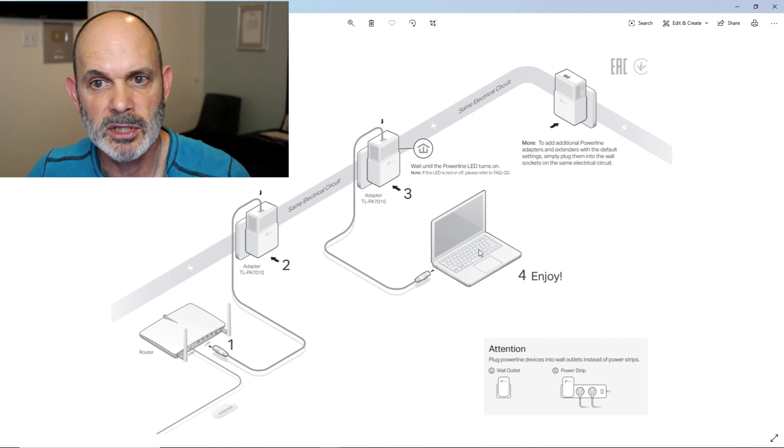Here's what you're going to have after doing that first video: two routers connected together using Ethernet cable. In my case I have an Archer C9 TP-Link router connected to a Linksys EA8300. They work great with an Ethernet cable patched into the LAN port on the EA8300 and one of the LAN ports on the Archer C9. The internet port on the primary goes to your modem, and the internet port on your secondary router is not used at all — only the LAN ports.